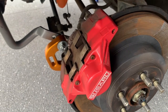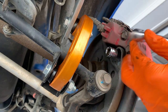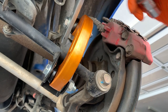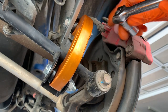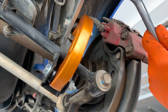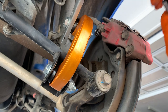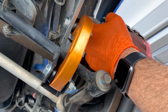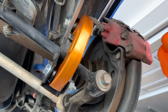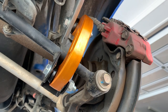Get the 14mm on the nuts on the back and we'll break those and get that out of there. That's the bolt we want to remove right there. Get the breaker bar on it because it'll probably be pretty tight. The torque settings on the front were 80 newton meters. I'll break the top one. We've got an extension that'll be able to do it. Watch your brake line, of course. They're not on as tight — I think these have been done recently, so that'll explain that.